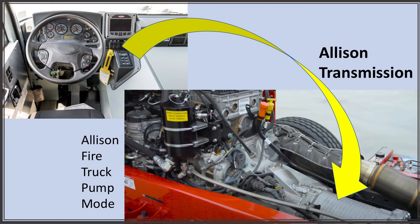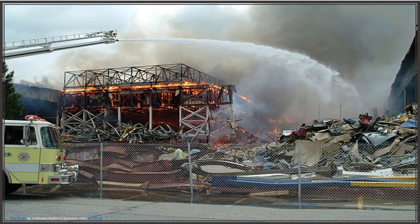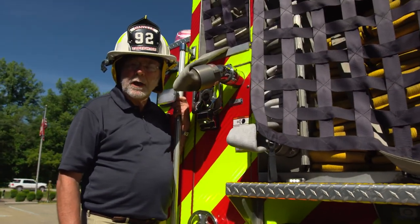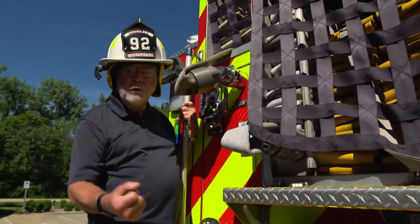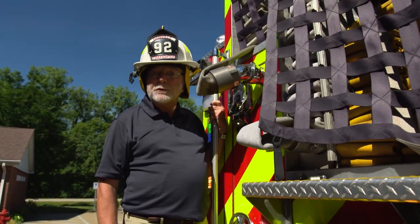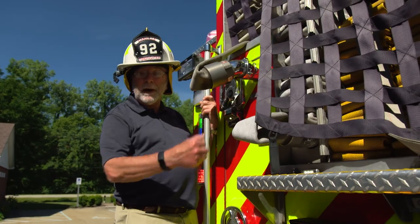that's fourth range on the 3000 and 4000 transmission families. When operating through the split shaft, we wouldn't want the firemen to be operating a fire hose a hundred feet in the air and have the transmission make a shift, resulting in a drop in pressure. Fire trucks, vacuum trucks, and concrete mixers need huge amounts of power to perform their operations successfully, and it's only split shaft PTOs that can provide that power.